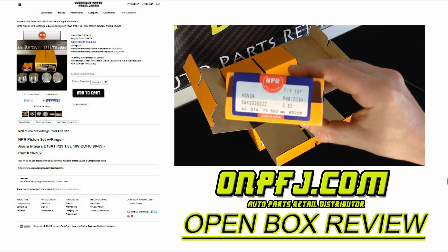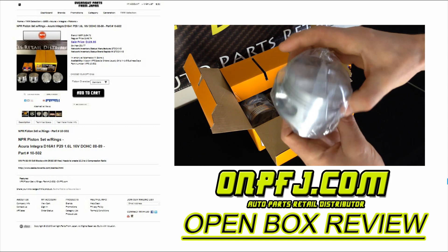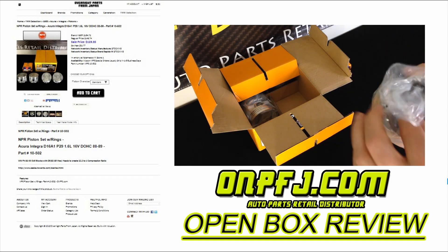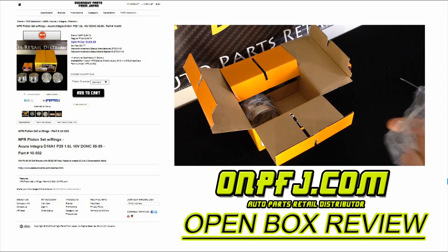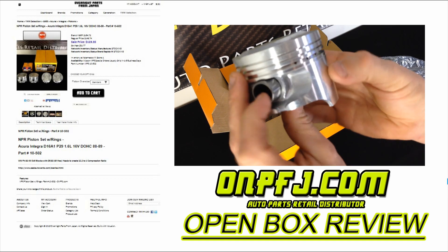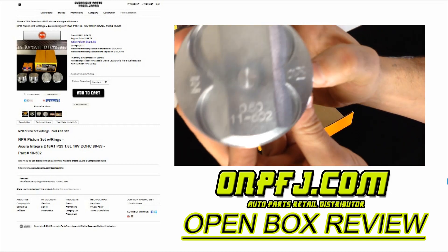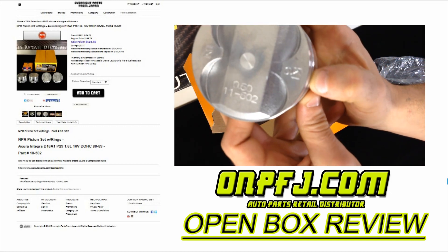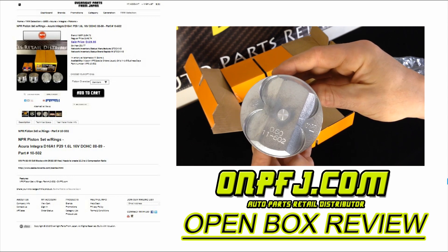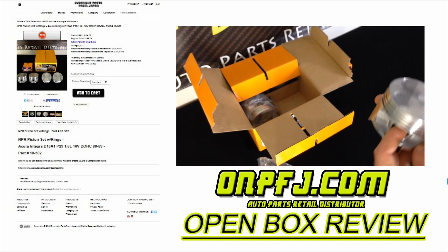There's the part number if you need it — I can put that in the notes. Getting this piston out — the bag and the wrist pin are actually kind of pinched in there, so I have to take it off camera to pull it apart. This isn't the first time I've seen this with pistons; the wrist pin slides out and pinches the bag. As you can see, the wrist pin slides in here very smoothly — that's how they should show up when they arrive. If your pins are real seized and don't move, you probably need to give us a buzz and send them back. The machine shop guys can clean them up with one of their tools before they hang their pins.